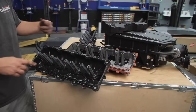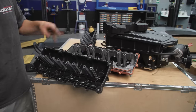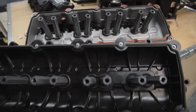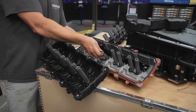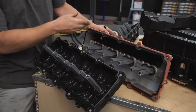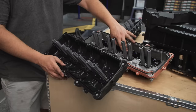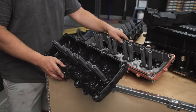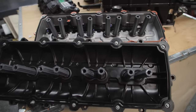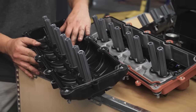Getting things off and comparing them — taking a look at the valve cover difference between a Hellcat and the 392. It's a composite, no baffling or anything. But on the Hellcat valve cover, there's an added little boss with the filler and the PCV built in. Always got to keep positive crankcase ventilation in mind when you're building an engine, especially when racing. We'll address that when we get there.